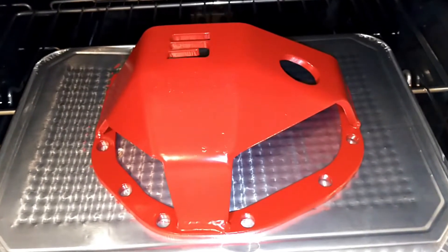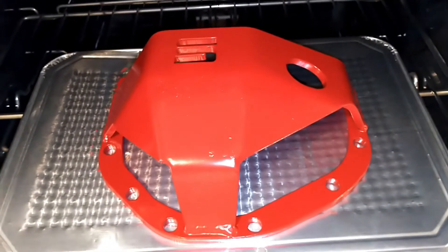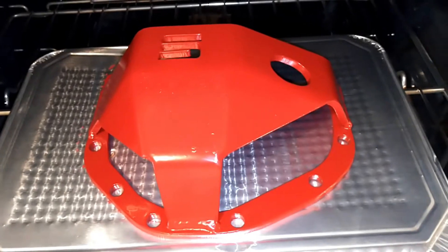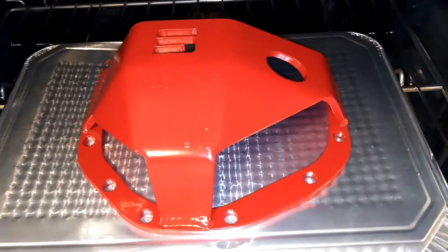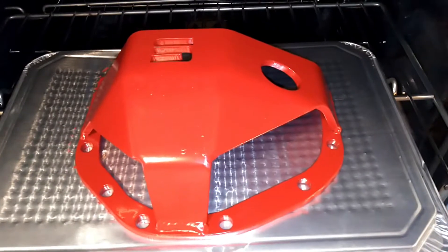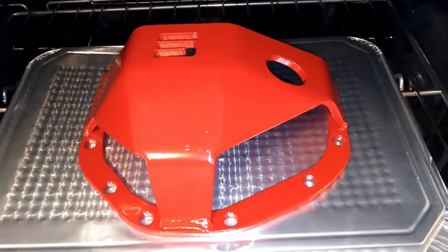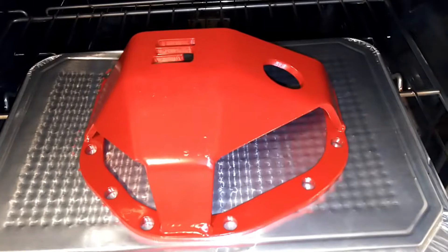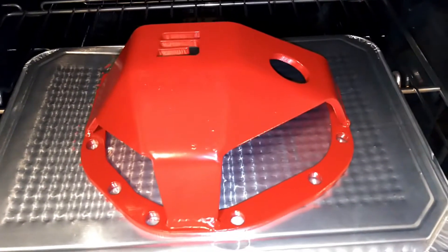This is basically a diff girdle and also armor plate to protect the rear sheet metal pan, which on a Nissan axle is very vulnerable to impacts. My understanding is that Toyotas are built a little differently and are more like a Ford type, where the gear set comes out from the front and is a lot more well protected. The Dana Nissan design, which is very similar to what Jeeps are using, loads the gears from the rear and just has a sheet metal pan. Because of that construction, they are a lot more vulnerable to rock impacts and damage to that cover, which could allow all of your gear lube to leak out.